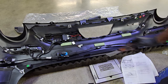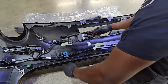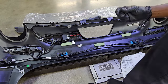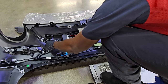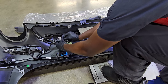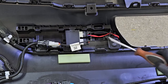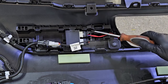There's a push pin hole where the double-sided tape is going to line up. Go ahead and remove the backing on the double-sided tape and align it with the push pin tabs that are already there. Apply a little pressure to the bumper to make sure it sticks, then go ahead and pop some push pins in. You only need two — the two you removed from the old kick sensor bracket, just save those for the new one. Apply some pressure to make sure the double-sided tape sticks, then plug the little sensor harness to the original factory harness and clip it on.